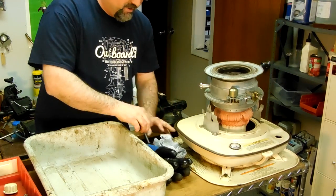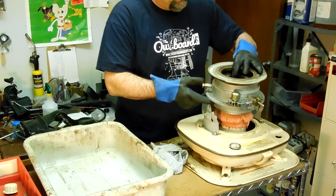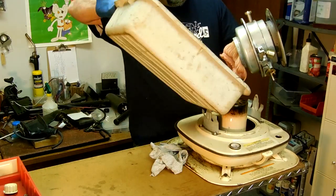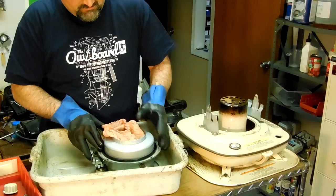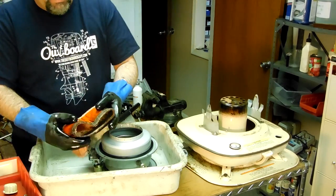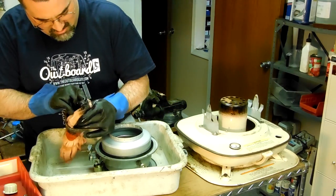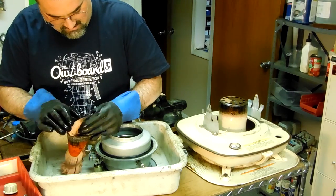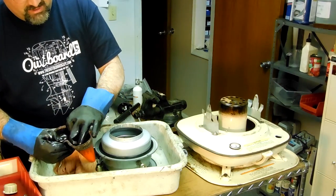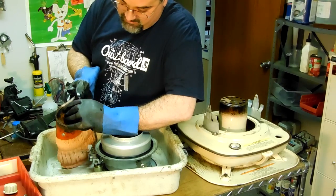Now that I've pulled this off, I can see what my problem is with this wick — it's carbon buildup. You can see this wick has got all kinds of carbon buildup in there, and that stops the wicking action. The kerosene can't go up through that carbon. When it's this far down, dry burning doesn't help. I dry burned it and it's cleaned up above, but the carbon is so far down that dry burning didn't get it out.